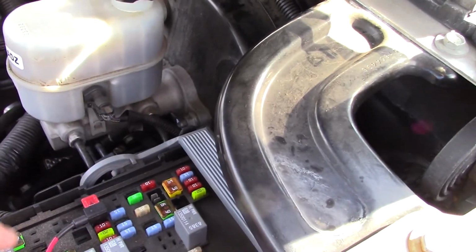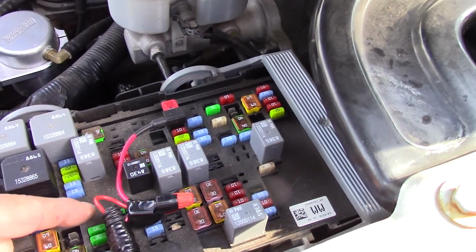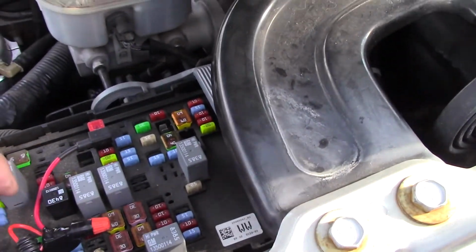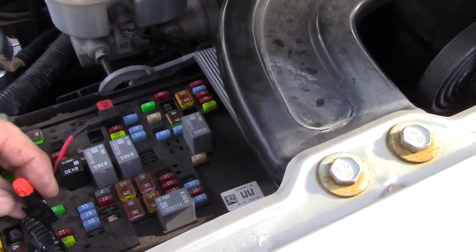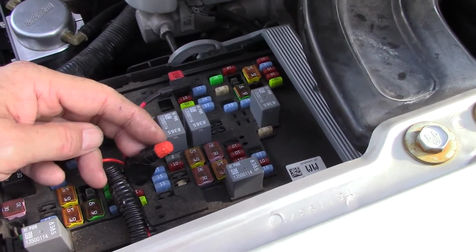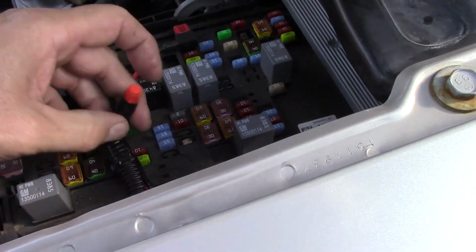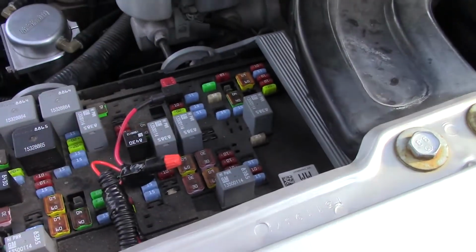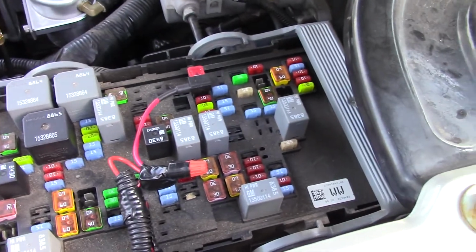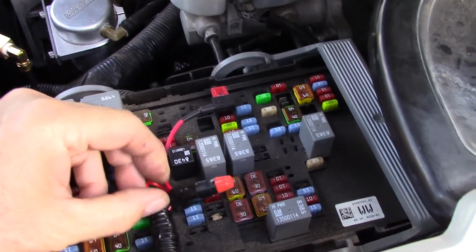And then I have it cut twice because I have a dash cam in here also. So that's why there's a wire nut. These things will unscrew if you're under vibration, but what I do to solve that problem, I just put electrical tape around it and I tape it up, so then there's no way it's going to unscrew. So that actually works out really good for me. It's faster than soldering. I'm not the best at soldering. That's why I do it with the wire nuts.